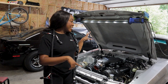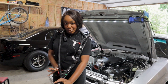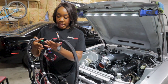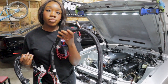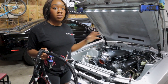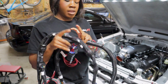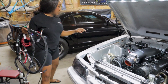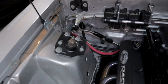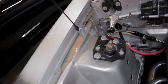You saw us mount the smart coils on the car, and now we are going to be installing my new HB harness. I am switching to a new harness because this one will be compatible with my new distributor and the smart coils. We taped it up here because we are going to put it through this very small hole in the firewall — the tape will hopefully keep the connectors together and keep it from getting caught when we transfer it through.